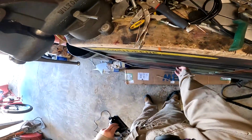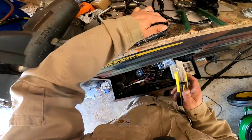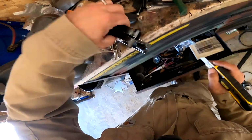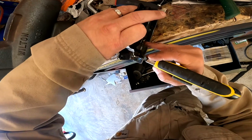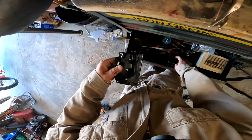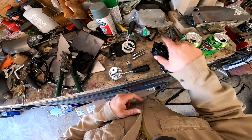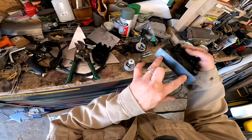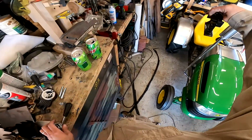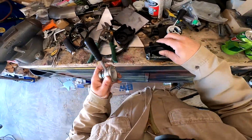Oh, so if you couldn't tell, the purpose for those little angles is to stiffen it up side by side. So when I'm pushing the forward reverse shifter against this spring, it doesn't wiggle the whole bracket. So now instead of mounting through, they're already there. Now I have some mounting through down here. And they can both go side to side. I'll be able to drop them in a hole, bolt them, pick them up out of there to service it.